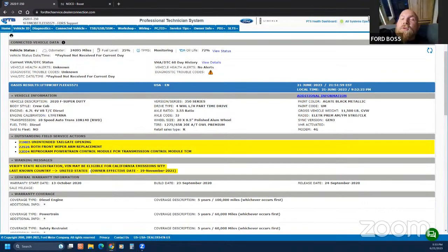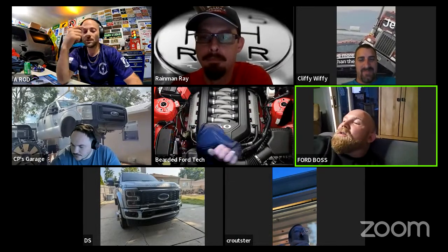You see, I got the LSD installed in the Grand Marquis. Yeah, I got the Yukon Posi Track in. Did you have him put those tailpipes on to make it look like a Marauder? Yeah, it's got the shotgun pipes and everything, just like the Marauder, and those are dope. It's a rear cat delete because it's not monitored. 2.5-inch pipes, Flowmaster X pipe, and then the Super 40s. And then I just got done with the massive rear suspension, so I pulled all the factory stuff out and added all new upper and lower, and then Watts Link tubular suspension with polyurethane bushings, and then Ford Racing 373 gear set with a Yukon LSD.